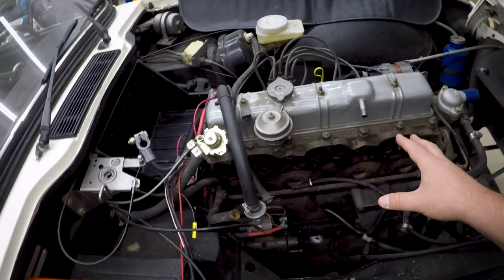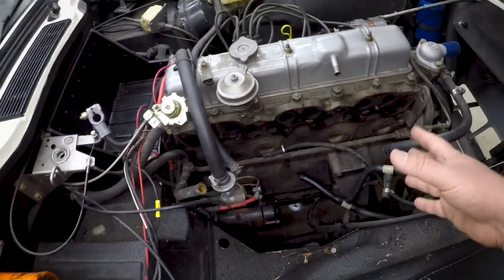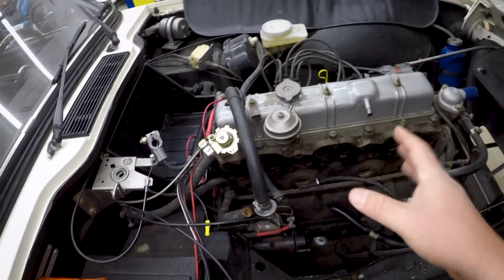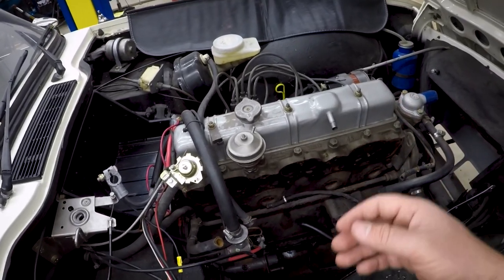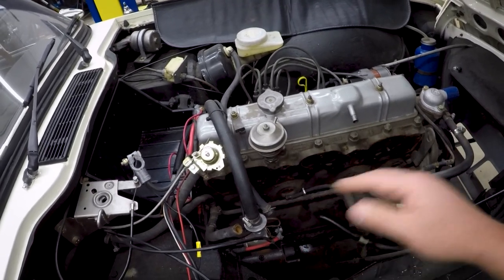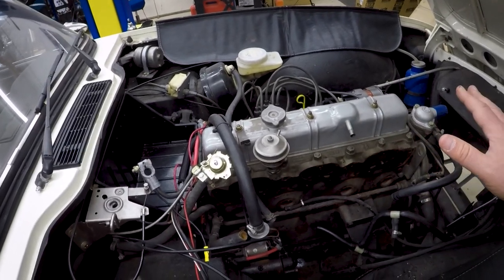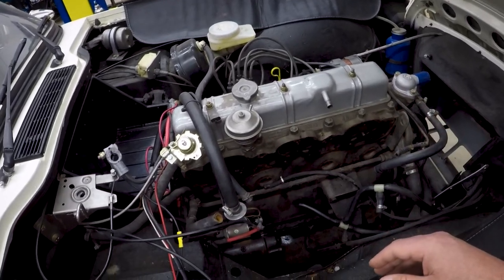The intake manifold was a bear to get off. It had corrosion all over these locating studs, and somebody had broken off a couple studs and either put tack weld on there or there was corrosion buildup, something that oversized the head of the broken studs so that the manifold didn't want to slide off of them. So that was a little scarred up when I got it off. Plus, the surface area didn't look like it had been treated well in the past, and there were gouges and things. So I sent that off to get it surfaced, and I'll powder coat it before it comes back, since it'll all be nice and clean.